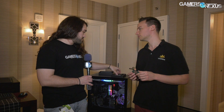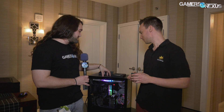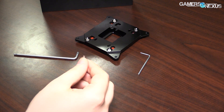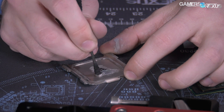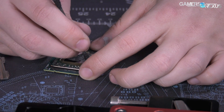As for risks — typically without a frame you risk cracking the die, so is there a torque spec for tightening the cooler? That was one of the biggest challenges: maintaining even pressure on all the PCBs to push them down into the socket equally. Too much pressure on the top PCB could cause the bottom one to lose socket contact — you lose memory channels, PCI Express devices. The tolerance is really tight on this, especially the bottom dimensions that touch the PCB. The very thin part on top is 0.52 to 0.58 millimeters, and it's not even 0.1 millimeter height difference to the core. So no matter what, once it's mounted, you're not going to crack the die.